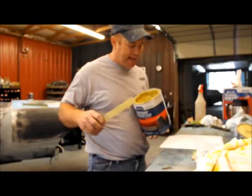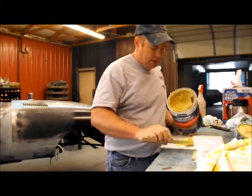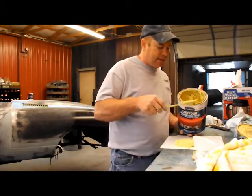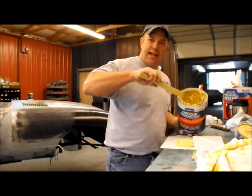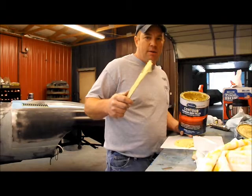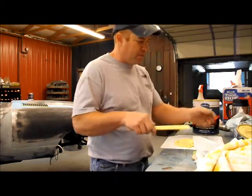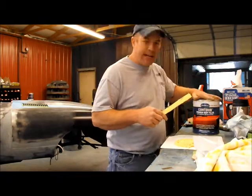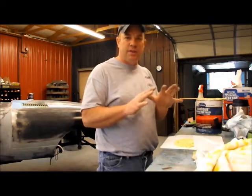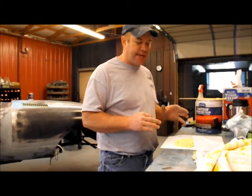Now I've been spreading for a few days, so I already know about how much filler I can get on and work out. You need to make a good judgment of that and try to mix the same amount each time. If you mix up your filler and it gets hard before you get time to spread it all out, you can either reduce the hardener a little bit, or just mix up a little less. You need enough time to get all this filler on there so you don't waste any, and plenty of time to work it down smooth and level. The smoother and more level you make it, the less sanding you will have to do. Here we go with the spread.